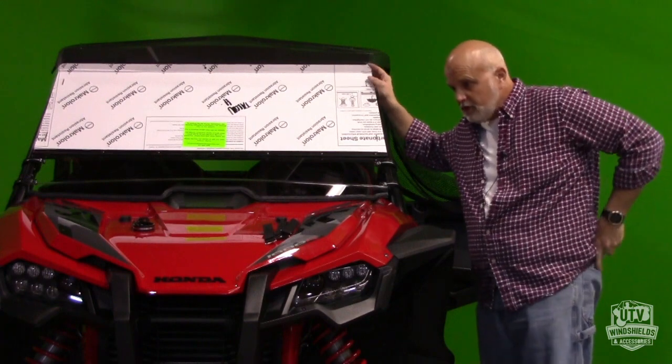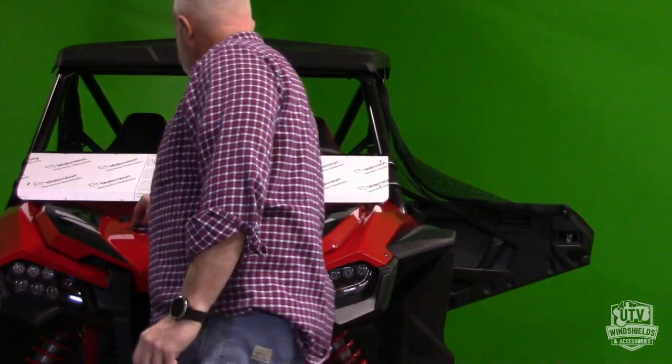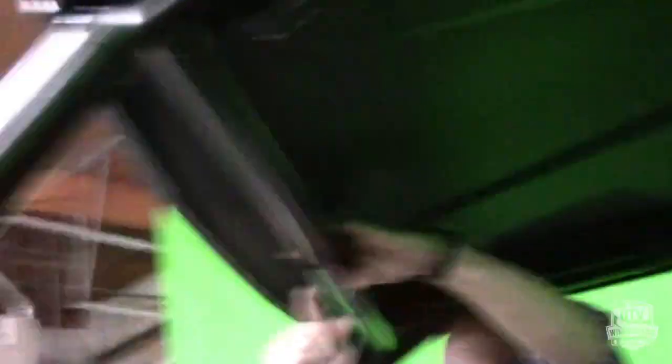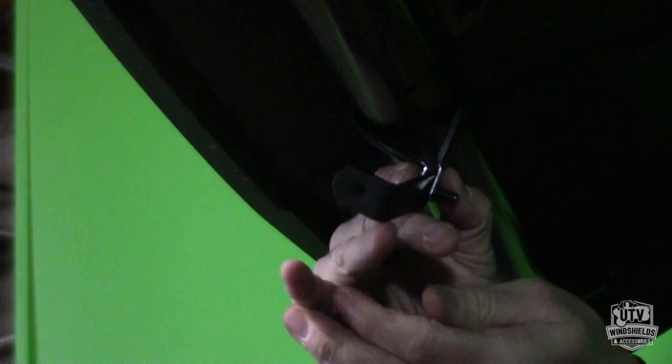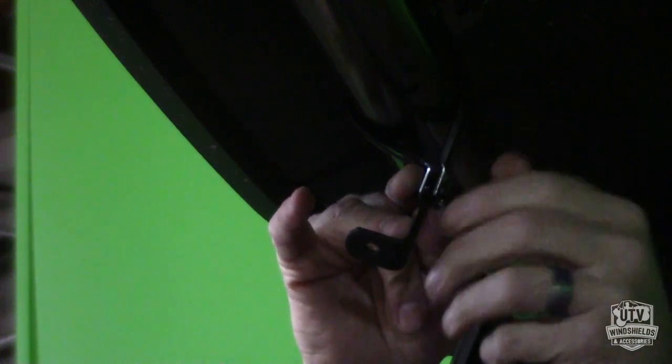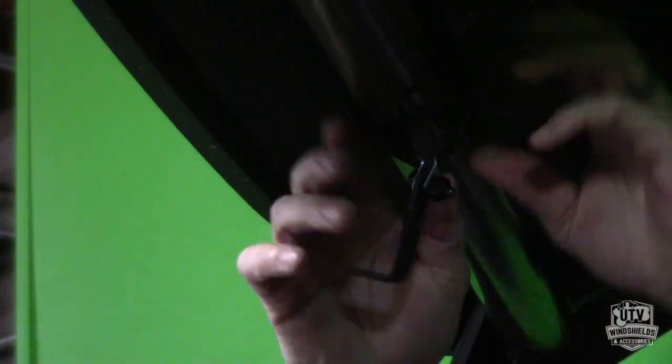Our bottom is now connected. We can hook up our center support bracket. There's a center clamp in the center that's welded onto the roll bar, so this bracket is going to go to the passenger side of that. Your center support bracket will be slightly off-centered because of that support, but it works well that way — that's not uncommon at all. Put the bolt on, nut and lock washer. I don't recommend cinching this one down yet; I like to tighten it up once I get the windshield up because I get a better fixation.